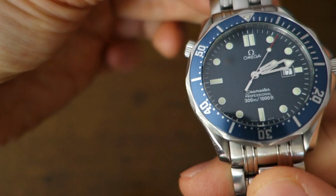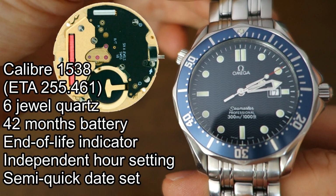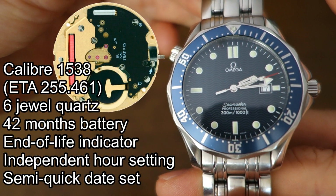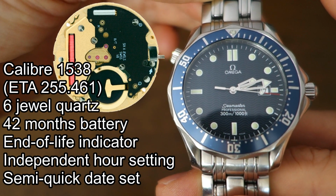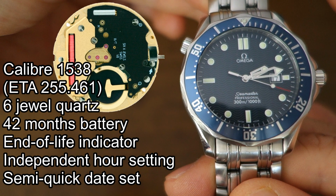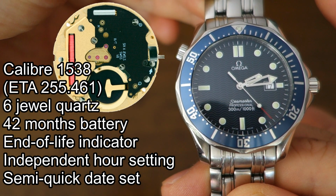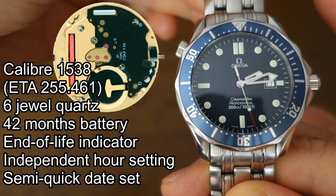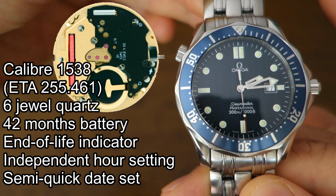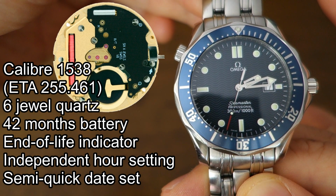The movement in this watch here is a little bit different. Whether you call it a high-end quartz or not, this is a caliber 1538, Omega 1538. It is based on an ETA quartz movement, the 255.461. It is a 6-jewel quartz with 42 months estimated battery life, end of life indicator, meaning the seconds hand will tick along 3 or 5 seconds at a time when the battery is low.